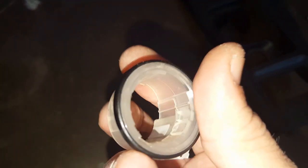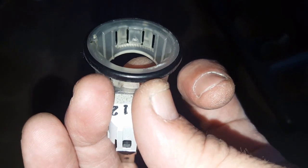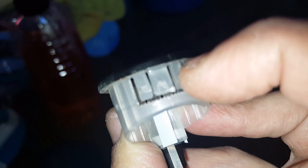On this piece right here, there's a clip on the inside — right there in the center of the screen — that big clip in the middle is what's holding on to the metal sleeve. There's one on the other side too. You can get to the back side and stick a pick in this big clip right here and try to pull it up. Here's the other big one in the middle, and these two clips on the side.